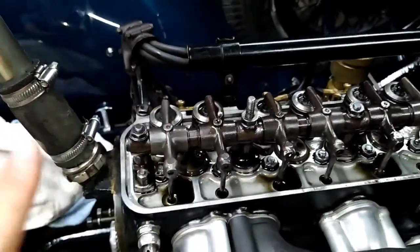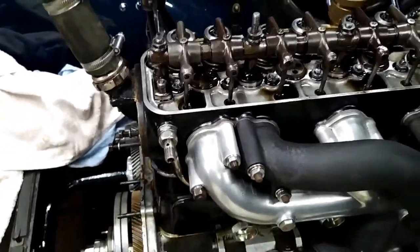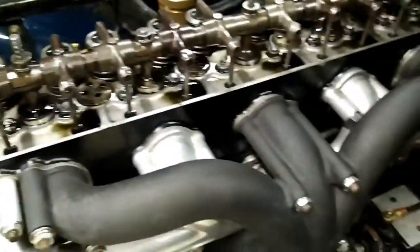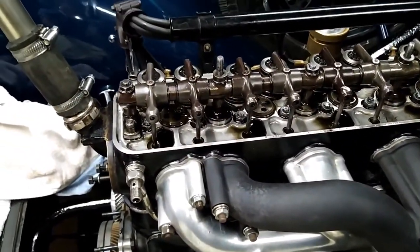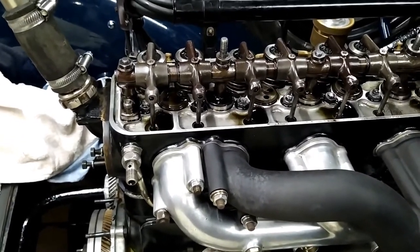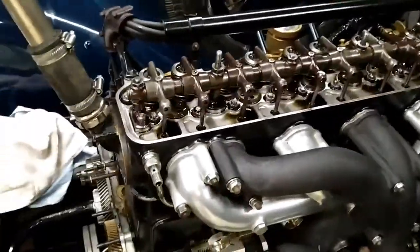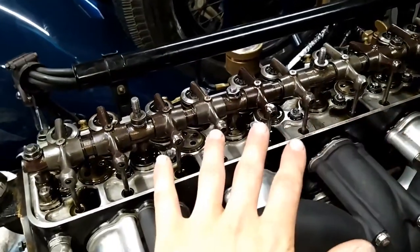Then we move to the front ones. This is absolutely imperative when you are setting valve timing on a pre-war Rolls-Royce and applies to any model. We have to set number one cylinder inlet valve and exhaust valve to 20 thou clearance. This is applicable to this car because that's what it says on the flywheel. If you have a Phantom 2, for example, it might be slightly different — so you must read TSD 2066, which is the valve timing and ignition data provided by Rolls-Royce. Make sure you read this before doing anything valve timing or ignition related. We set the 20 thou valve clearance using the same method as the 4 thou clearance.